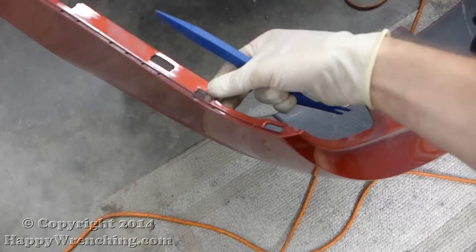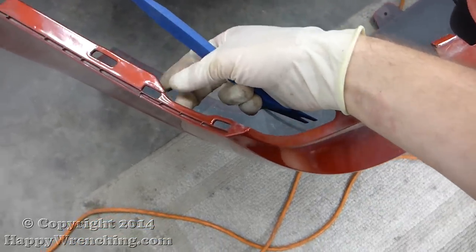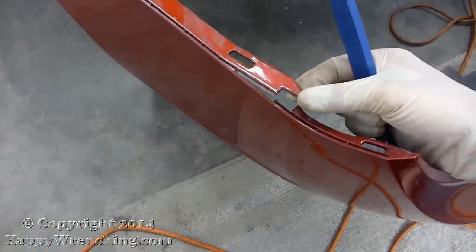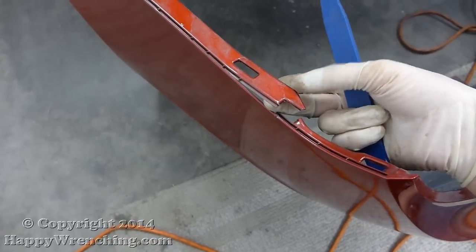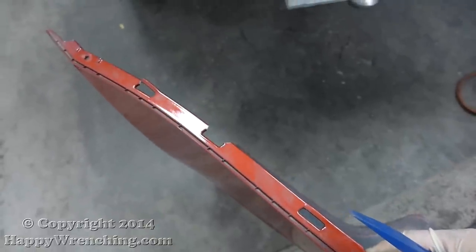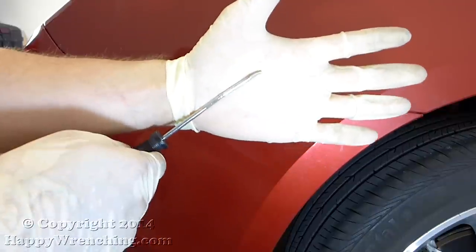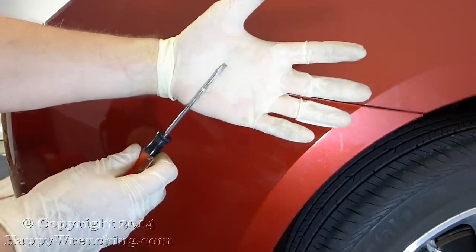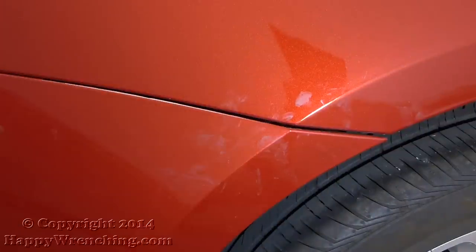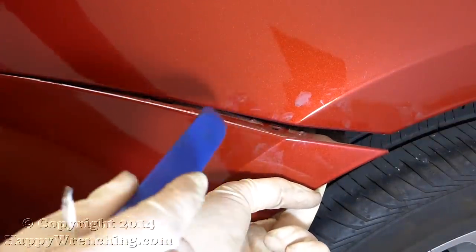Here's an example of what not to do, because you really have to be careful when doing this part. The plastic is very thin, so if you go yanking on the bumper without carefully pushing down those hooks, it's going to break these tabs right here. I'm going to be using a flathead screwdriver that I went ahead and bent the tip a little bit — this will allow me to reach back in there and push down on those hooks. I'm also using a plastic trim removal tool to push down on the bumper and give me a little bit more room to work with.